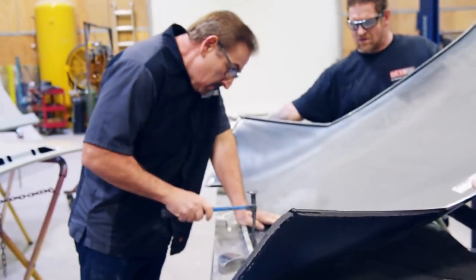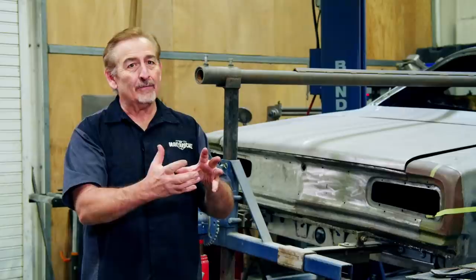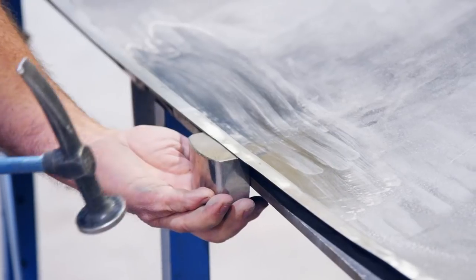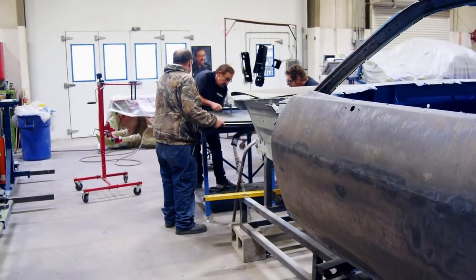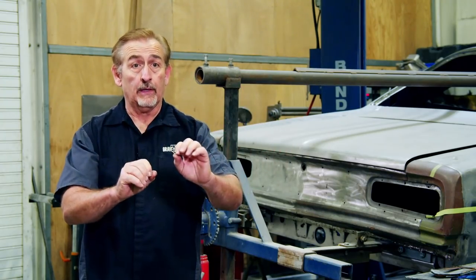One of the things we have to deal with is damaged parts — sheet metal is the most vulnerable. In the case of our roof skin from Auto Metal Direct, we unboxed it and it had gotten folded almost by a third at the back half of it, meaning the rear window opening and sail panels aren't right. I can't put that on the car without getting it roughed out first. We roll that roof up to where we can get the pinch weld exactly down on a flat plane — works like a dolly. We go through and metal shrink it, tap and straighten until we get that nice opening at the back window, then shape the quarter sail panel area and stress-relieve areas where it buckled.